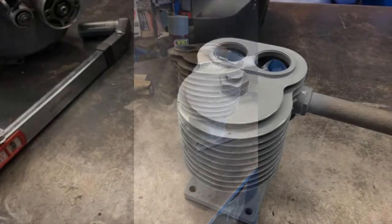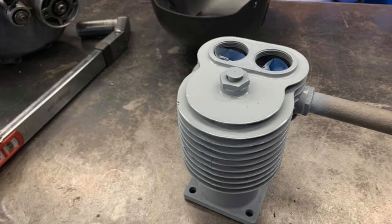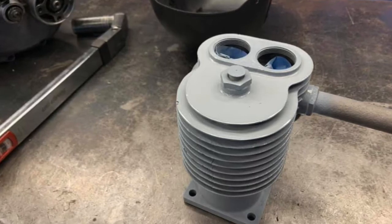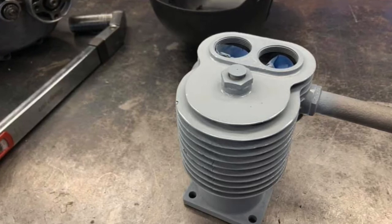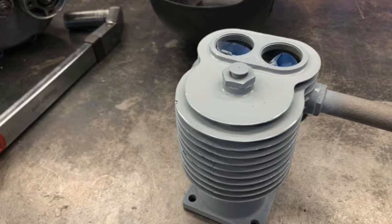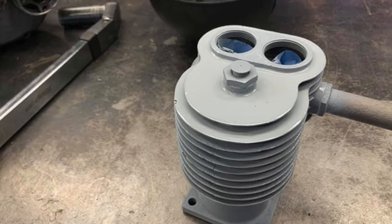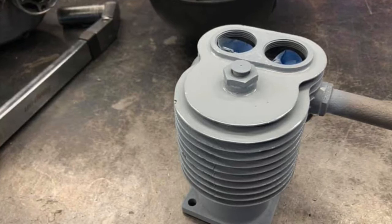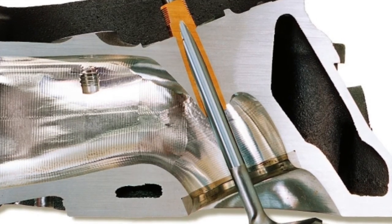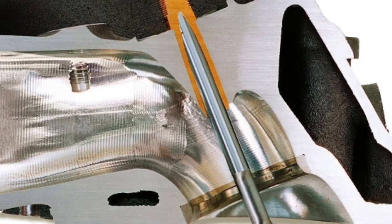Here we're still working on the fins. Now here's the finished result — the fins have been repaired, cleaned up and painted, and the barrel itself painted. You can see tape over the valve seat holes. We had to bore down into those holes and fit hardened valve seats, which is common practice. That dark piece at the bottom of the port is a sintered steel or bronze valve seat pressed into the head, and the valve comes down to seat from it.